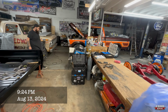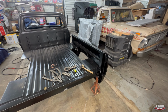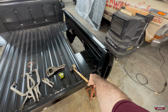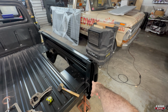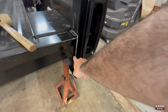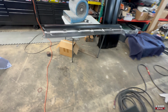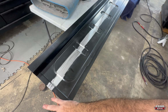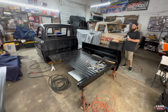Guys, so we are closing up for the day. You saw a bunch of B-roll, and basically Cody assembled the center of the bed, welded these four corner pieces on it, and then he dropped the bed side 6 inches. So he so far did the passenger side. He raised this up 6 inches on the other side, and then the header panel he cut right out of the middle, and then TIG welded everything back together, smoothed it back out. Tomorrow, it's on to that side.